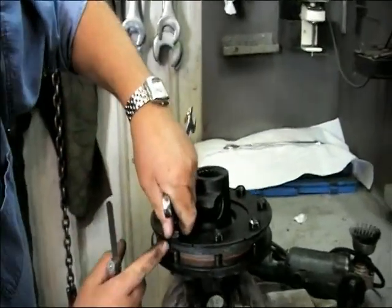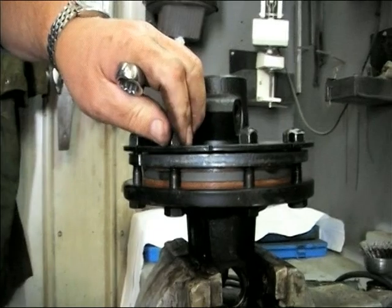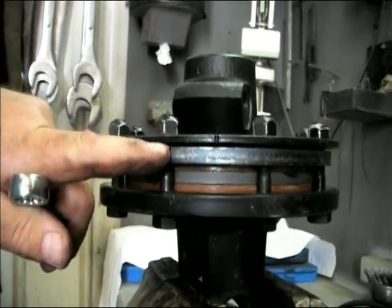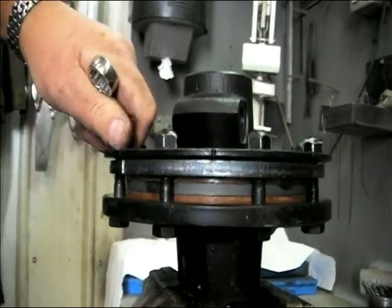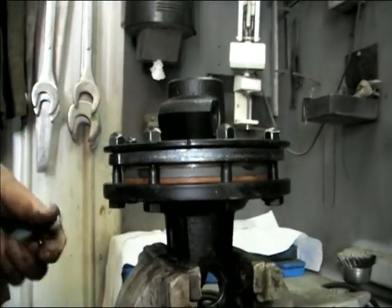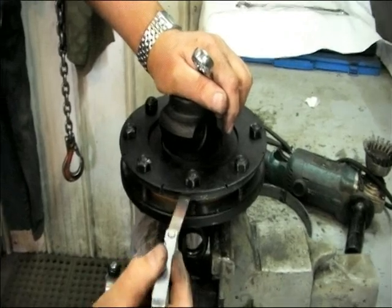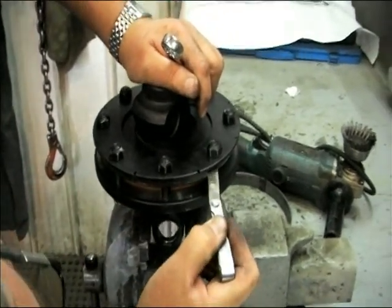I've tightened up the bolts evenly all the way around. And if you look closely, you can see this is a 25 thou feeler gauge. You can feel that I can get that in there quite easily. If you tighten up this spring plate too much so that it starts putting clamping pressure on this plate, you will have way more torque on the clutch than you intend, and that will cause other driveline components to fail because the clutch is not going to be operating where it's intended. So we're going to tighten these up just a little bit — it doesn't take very much to get them close. Check them right at the bolt — this is just starting to fit snug. You should be able to butt it right up against the bolt and you're going to be good to go.